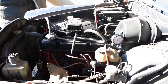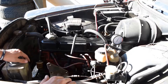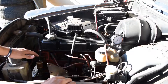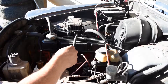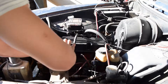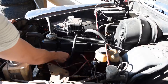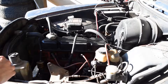One trick you can do to see if it is either the rings or head gasket is if you put oil in the cylinders — just a small amount of oil — if it raises compression, then your rings are bad. But if it doesn't do anything, then it's most likely head gasket, or the head's warped or something like that. We can try and do that. I'm only going to put oil in the number two cylinder, just because that one seemed to be the lowest at around 115. We'll see if the rings are bad on cylinder number two, and if it's not the rings on cylinder two, then I don't think it's the rings on cylinder three. I would think it's the head gasket.